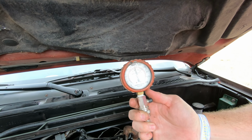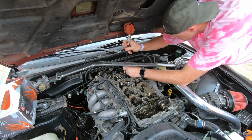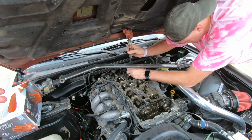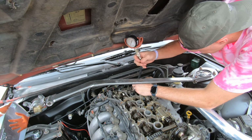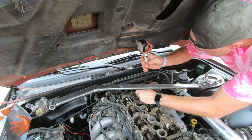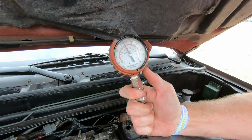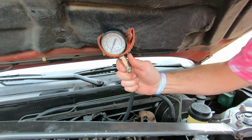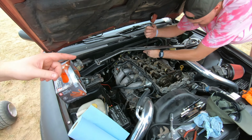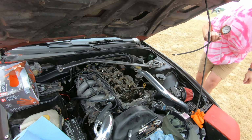That's about 150 in it. It sounded like it was coming from the front of the engine. It really did, didn't it? Oil pressure looks good. We're not hearing it now, are we? No, we're not hearing it one bit. It quieted down after we started cranking on it, like after 3. All right, 145 on the fourth one. So that's to be expected because your knocking went away.